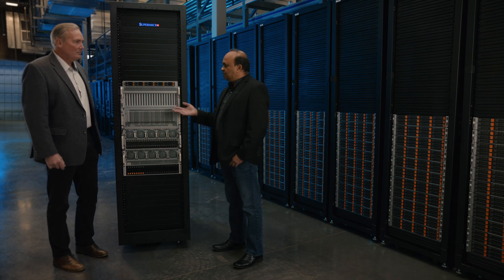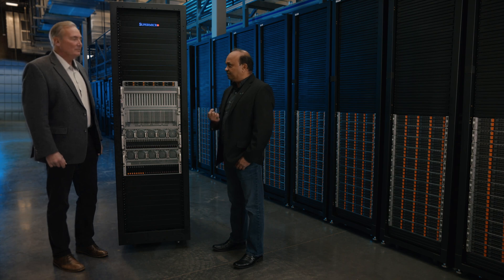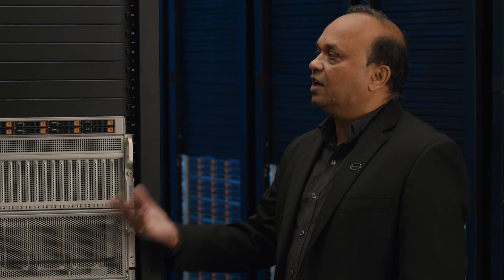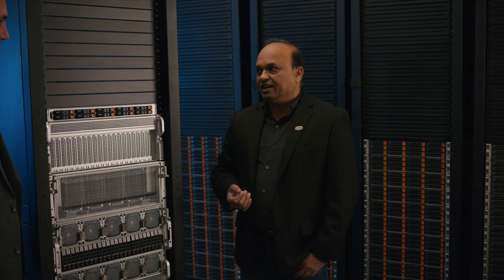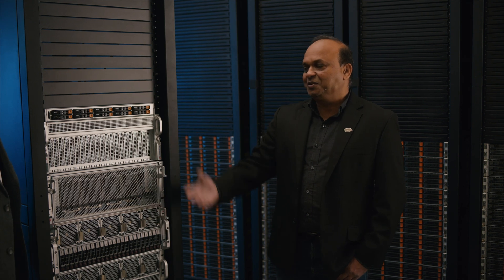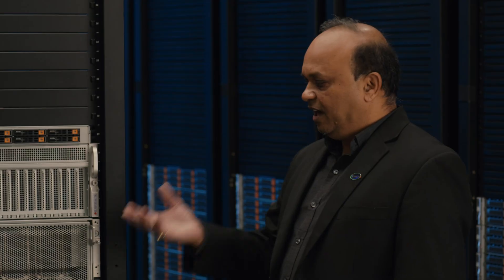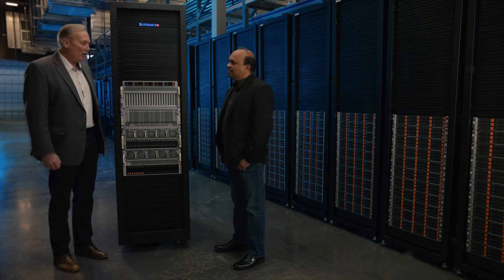On expansion slots, this supports PCIe Gen 5 bus, so it can go up to 400 gigabits per second. By default it supports 10 slots — eight are via PLX switch, so those are available for GPU direct RDMA and GPU direct storage, with two additional cards for additional networking. Very importantly on this particular system, there is also a DPU. The DPU is a third compute block at the node level: CPUs for serial processing, GPUs for parallel processing, and DPUs for infrastructure management.